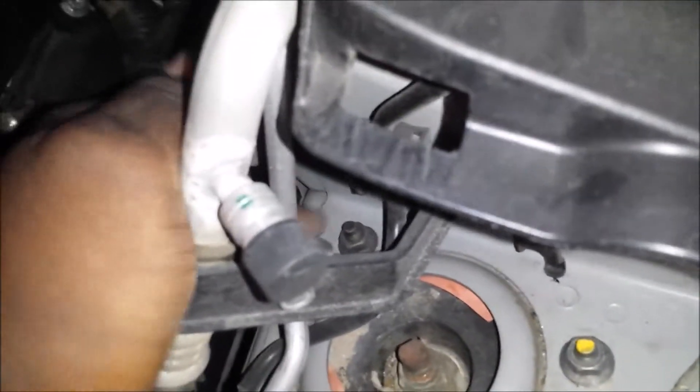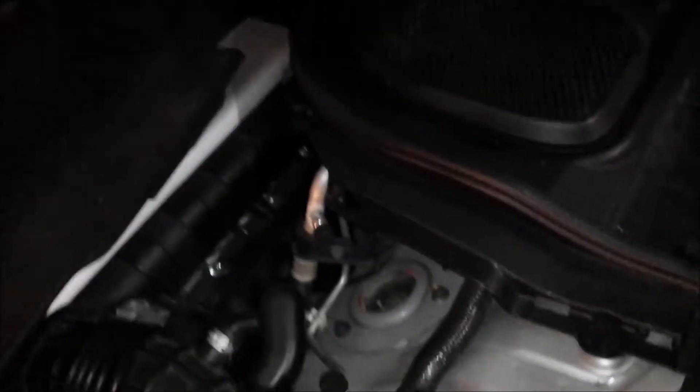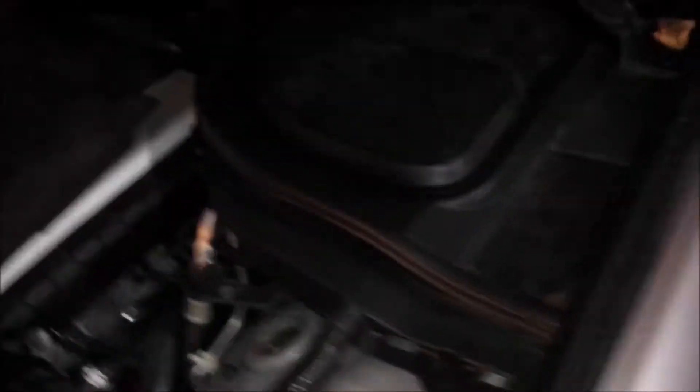The strut goes up through the body and attaches at three bolts. You'll notice that unlike the 2003, this 2008 does not have any strut tower support bars — this is a very well-made, stiff platform. The stabilizer bar is here, pretty beefy, and the stabilizer link — in Nissan speak, the stabilizer bar connecting rod — joins the stabilizer bar to the lower wishbone.